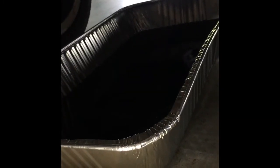So I'm currently under the car, as you can see. I've already started the process, but I can just go through the steps again. I've just got a catcher tray to catch all the oil because it can get quite messy. What I've done is I've located where the sump plug is. If you can see, that little thing on the side here, I'll bring it around. Get the light. That will be the sump plug. So that's the bottom of the engine. That's where all the oil, once it's stopped running, will collect. And once you open that up, it's going to pour out.